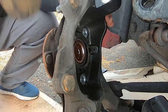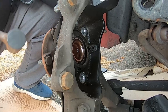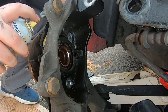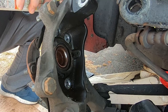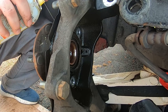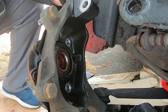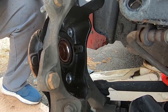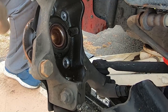I had a dead blow hammer but a ball peen did the job better. The main difference between the two is the dead blow has sand inside and is usually encased in a soft plastic material — it's meant to deliver a dead blow when you strike an object without damaging it. A ball peen is metal so you're going to deform the surface no matter what. I got the ball peen and banged it out — took a minute but it wasn't too bad. You can also see the side of the wheel bearing being deformed as I hit it, and there it goes.